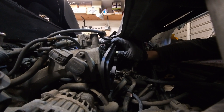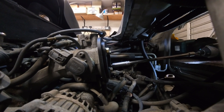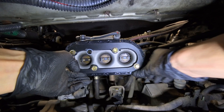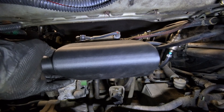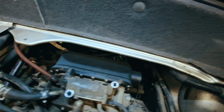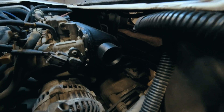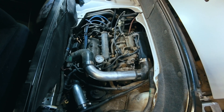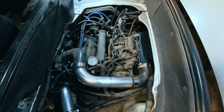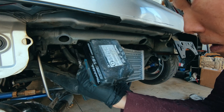With all the pieces completed, I can mount it to the engine. Bolting the plenum to the mounting flange was kind of a pain, but it was doable. If this version fails, I'll have to redesign that part to make it easier to install. With the plenum mounted up, I welded up a new charge pipe and buttoned up all the ancillaries, so the final thing to do is take off the old intercooler and take it for a test drive.